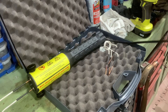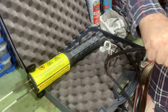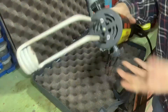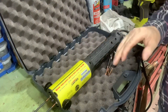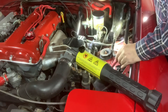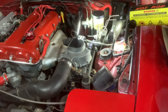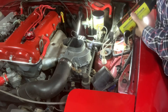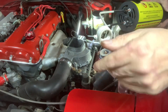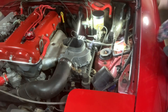Plugging it into an extension cord here. This thing has a light on the end of it, so if you're working under a car or something that's a bit dark, you can turn that on so you can see what you're heating. So I'm going to go set this up over on the car and we'll get started and give it a try. We're over here under the hood of my Miata. There's the shock tower, and we're going to attempt to break that one loose. There's another one on this side. You hold it over the nut — try not to directly touch anything, but it's not going to kill anything if you do. That's one of the reasons they have this heat-resistant fabric that coats the wire — so it doesn't ground out. If you tear or burn through this fabric, replace it; don't keep using it.